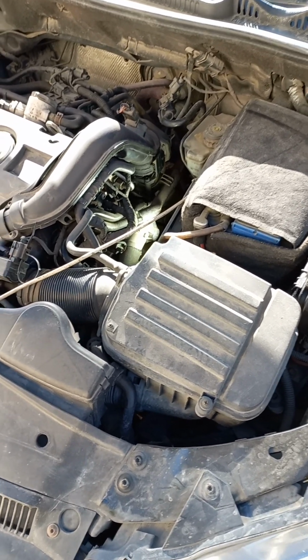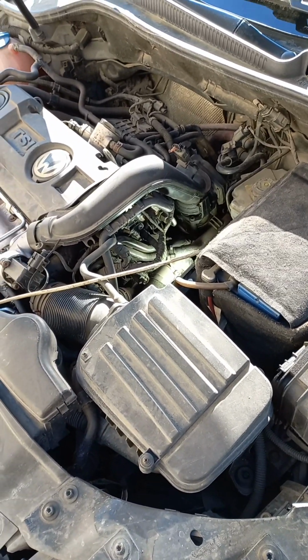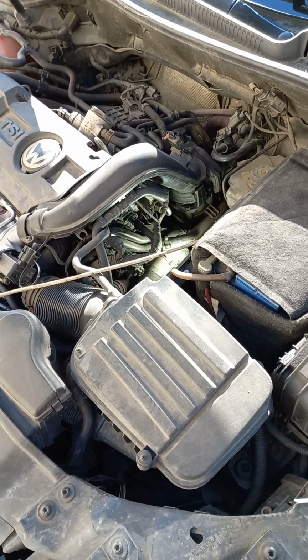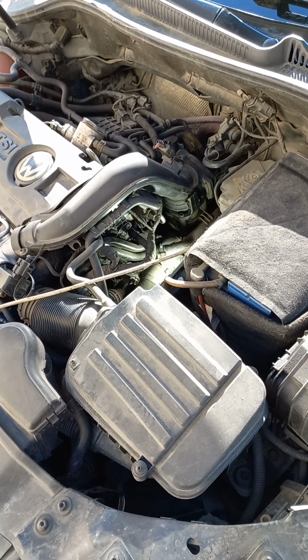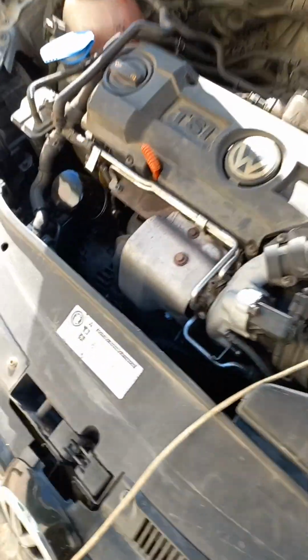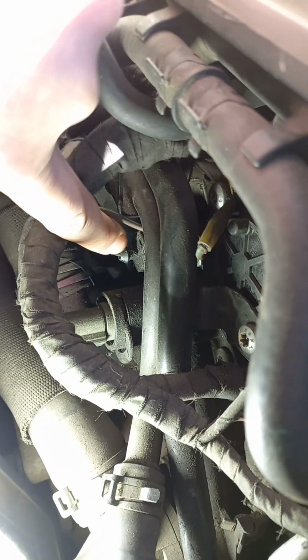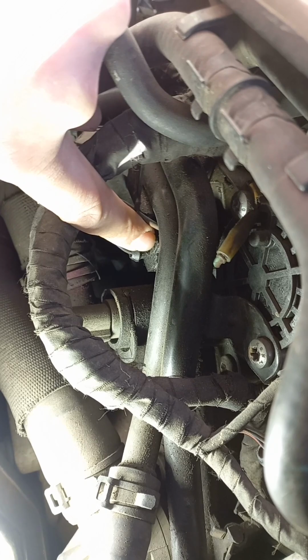Now we are going to measure the oil pressure with a mechanical manometer. Normally the gauge is installed near the oil pump or filter, but not in this case. One more peculiarity: the sensor readings are ignored up to an engine speed of 1800 RPM, and if you have insufficient pressure at idle RPM, you will not know about it. I will now try to show you where the oil pressure sensor is mounted.